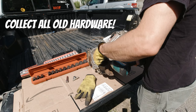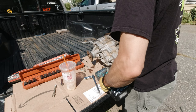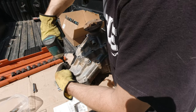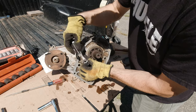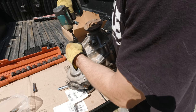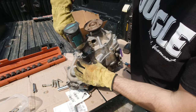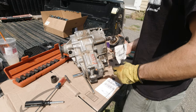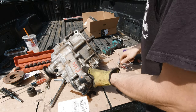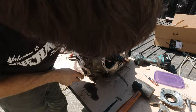I'm taking all the hardware out of it. Some of the hardware is a little frozen — this is an old case — so it needed a little hammering, but for the most part the impact took care of it. The vast majority of these bolts are 14 millimeter with a few 12s thrown in. Those two sizes should pretty much get the housings apart. There are also other little parts to remove: the bearing retainer clip, the four-wheel drive light switch, the speedometer sending unit, the oil fill plug, and the flanges — those have staked nuts you've got to pound out.